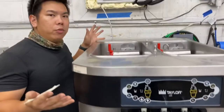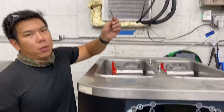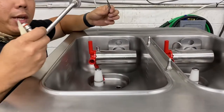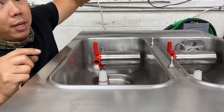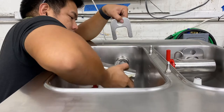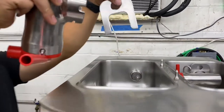To remove your pump assembly, all you gotta do is pull this pin — this is what holds in your tube. Then you come over, pull out your feeding tube, and then you pull this plate right here which locks the whole assembly in, and this should slide right out like that. This is your whole assembly, so let's move on to the table.